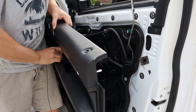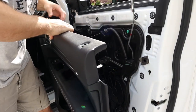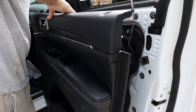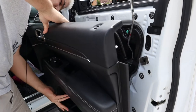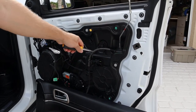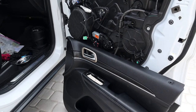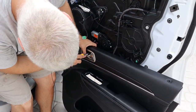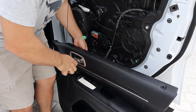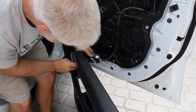This piece is your door controls or window controls. The only thing holding the panel now is the door handle. Let me take the handle assembly off — I'll take the Phillips screw behind the handle off, and that'll allow the handle assembly to come free. I undid the cable at the little yellow clip and let the door panel rest on the ground against the door. There we go — the door panel assembly is completely free. Let me set this panel aside and keep it safe.